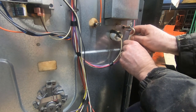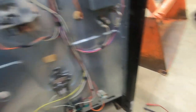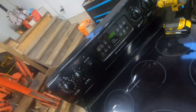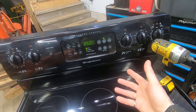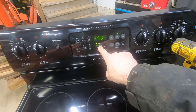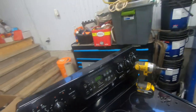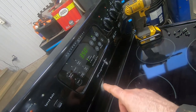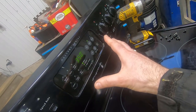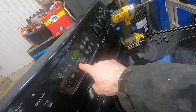So I'll rule that out as a reason why the burner is not coming on. Second thing: I'm going to turn bake on right now. I press the bake button, set it to 350, and if I wait a sec you'll hear a click. The oven light comes on and the preheat light comes on. The preheat light is basically this controller telling you it's not up to temperature yet. The oven light may blink on and off as the bake element turns on and off. When the preheat light goes out, that's when you're able to start cooking at the target temperature.